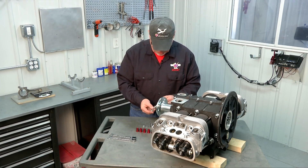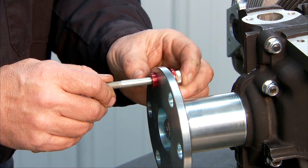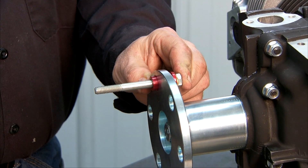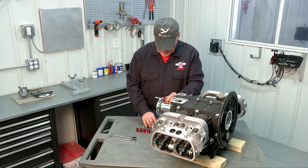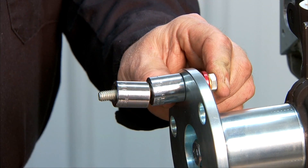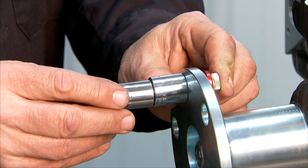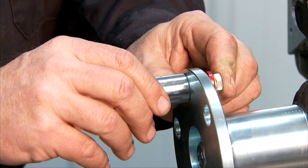So we're going to slide this on our bolt — it's just a standard hardware store bolt that you may have laying around. You can see that the lug only goes part way through the hub; we'll pull it the rest of the way with our bolt. Whatever length bolt you use, you just need some spacers to take up the slack. I'm going to put a washer on the outside and then run an appropriate nut on there.